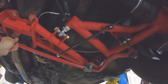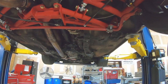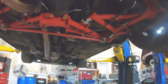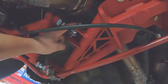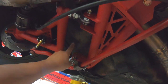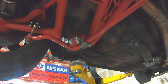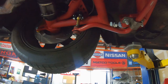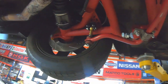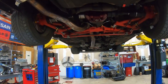For the parking brake, the cable brackets didn't get added to this crossmember. I'm going to fab something up here to make that work, but we're going to make sure it's on the production models — it was something that got overlooked on the initial couple of runs. If you need to adjust camber, there's a camber adjustment here and here — you just move the control arm tilt based on what type of camber adjustment you want. From here you can adjust your rear caster and your toe. Since this is a non-turning axle, caster isn't really a stability angle the same way as up front. If you wanted to center the wheel in the wheel well, you just adjust both of these evenly. Then you pick one or the other to adjust your toe angle.